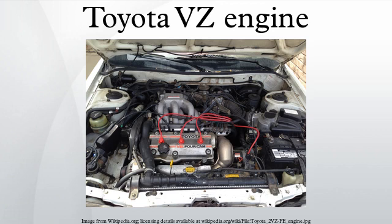The VZ was Toyota's response to the Nissan VG engine. The low-angle DOHC cylinder heads excel in low-to-mid torque and power, making the VZ well-suited for various uses in cars, trucks, and SUVs. The blocks are all strongly made using cast iron with large interconnected main bearing cradles and two-bolt main bearing caps.